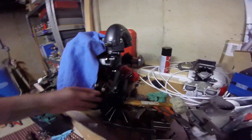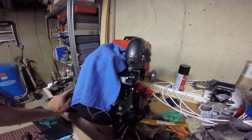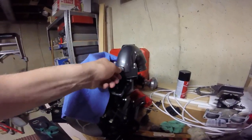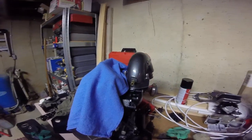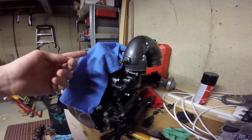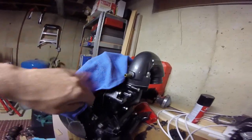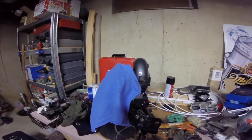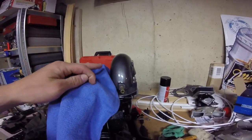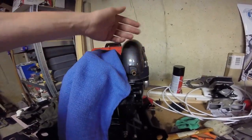Since I'm running a pretty heavily modified engine, I did want to get that extra cooling. These fittings are not hard to get, so if you mess them up, not a big deal. I went pretty large over stock size and it really does help your cooling more than you would think. Make sure you do the one at the pump — if you don't, that's going to be your bottleneck and everything else won't do anything for you.